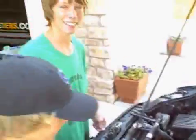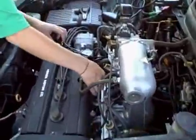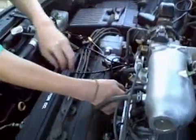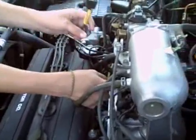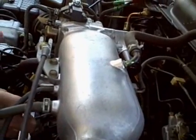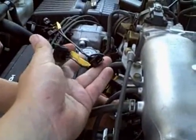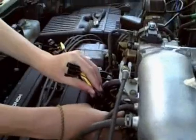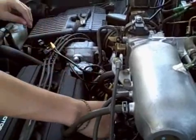Okay Ryan, we've got three more connectors to do. It doesn't matter which order you do them. You just have to make sure that since these two connectors are very close together — this one has to go on the injector itself, and then this one over here has to go to the corresponding wiring harness. So screwing it up is very difficult to do. I haven't known anybody to screw this up yet. It's a very simple, very easy installation.